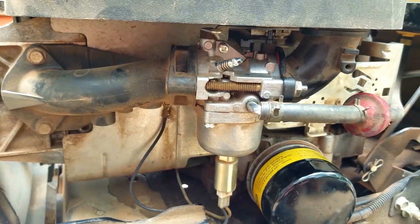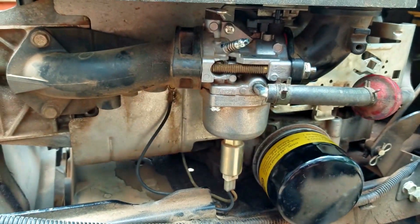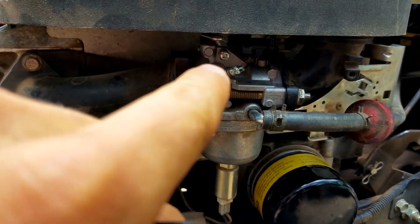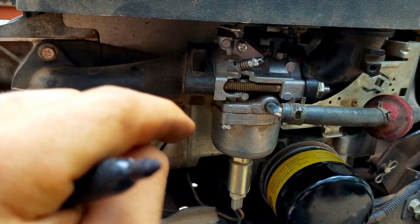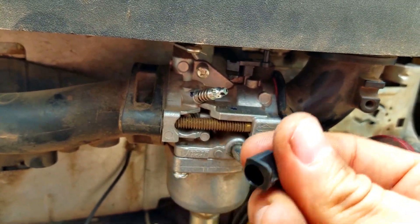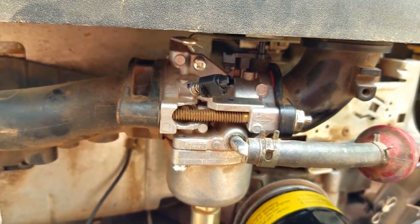Start your motor and warm it up. Once your motor is warm, come over here and adjust this until it runs best. Turn it in clockwise at half throttle until the motor starts to slow down, and then slowly turn it counterclockwise until the RPMs are running higher than they were before. Turn it back to the slow spot and find the midpoint between those two — that's where it needs to be set. Now get the little plastic keeper and pop it over the top and push it down on there — now the carb is tuned.